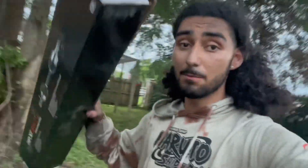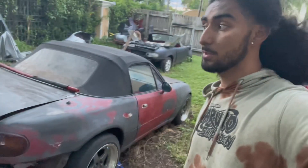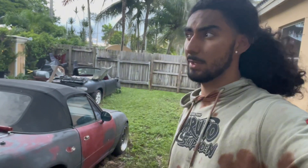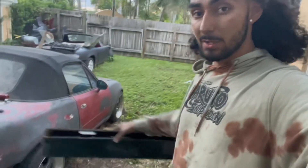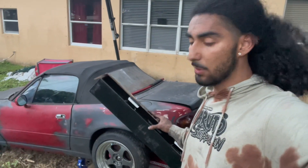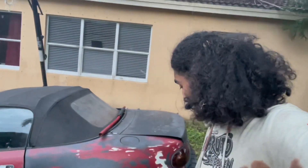I ended up having to take off the whole hub to put the new axles in, because I didn't realize these one-piece axles are a lot bigger since they go into the diff. The way I did it is I popped the hub out, stuck the axle into the diff, and then put the hub back on. I'm gonna get diff oil either now or tomorrow, fill it up, make sure it's not leaking, tighten everything, and then we'll go for a test drive. I'll see you guys tomorrow.